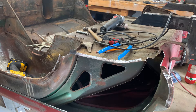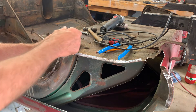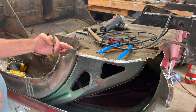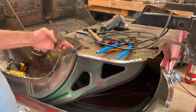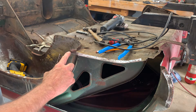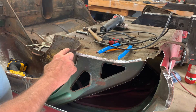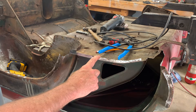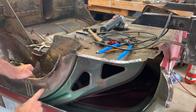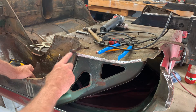My first little repair — I went ahead and cut this off. I drilled out the spot welds on the other side because I know I'm ultimately going to end up plug welding back to this ridge right here, but it was rusted out and gone. So I squared it up, cut a little piece, and welded it in. Now I'll grind this smooth and cut it flush so it's the same level. Then I'll figure out what to do with this based on what the repair piece covers.